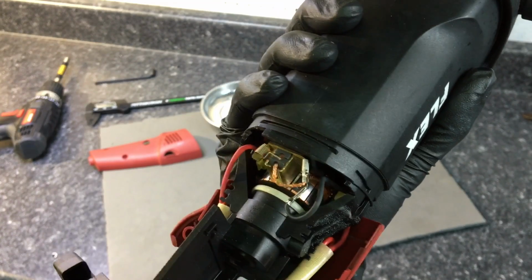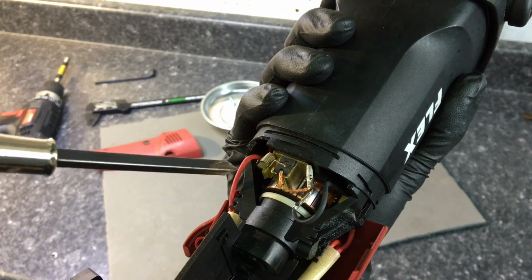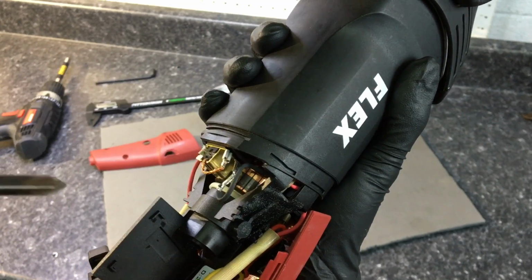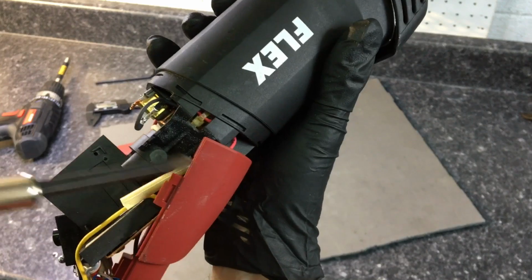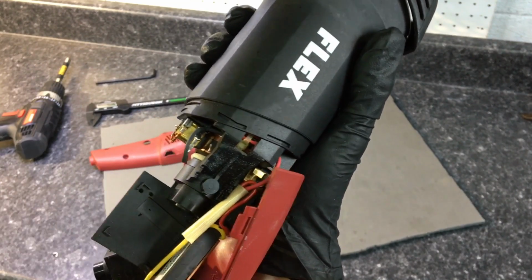The carbon brush has a sensor. Once it wears down and gets worn too thin, it triggers the system to shut down. So if your polisher shuts down one day right in the middle of a correction, hey, it may not be a huge deal. You just need to give it a tune-up, change the brushes, get back to work.